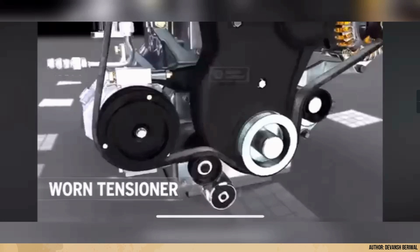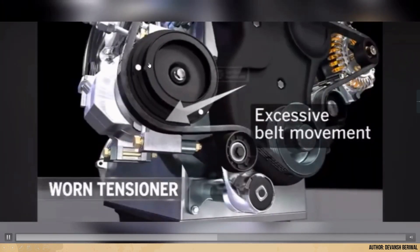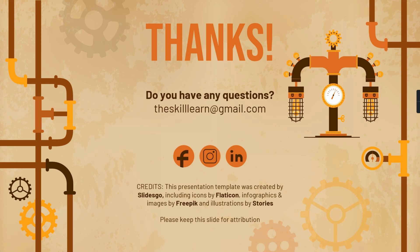During a visual inspection, check for misalignment or wobbling of the tensioner pulley — this can be a sign of a faulty or worn tensioner. Now we can see a faulty tensioner in action: it is jerking a lot and giving excessive belt movement, causing unnecessary loading on the damper and AC compressor accessory. When replacing the belt, always replace the tensioner and idler pulleys if there is a noise issue. I hope you liked this video — if you have further questions regarding the tensioner, FEAD system, or belt wear patterns, do drop a comment. In the next videos we will learn about dampers, idlers, and belts. The automotive series will continue — take care, bye bye, thank you.